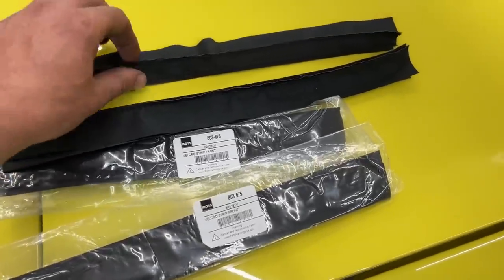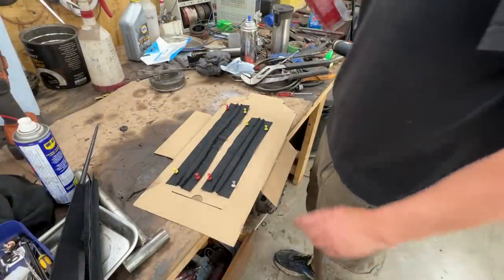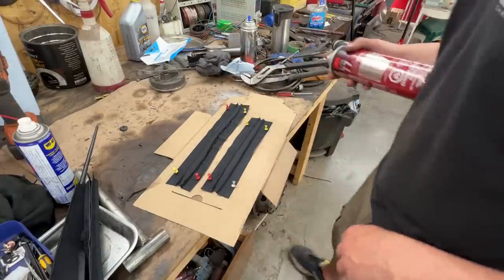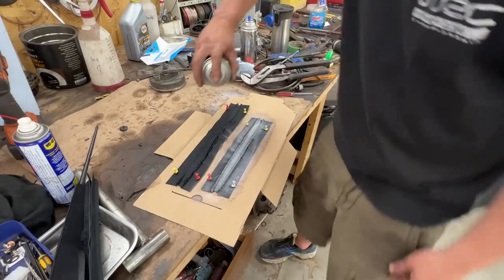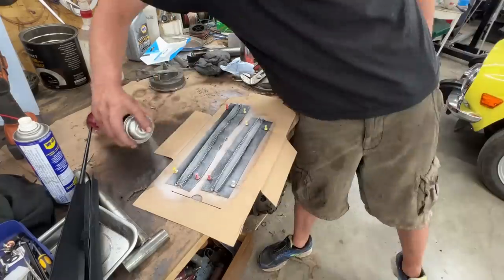So we have four pieces of vinyl with velcro stitched together - two long ones and two short ones. The short ones are for the front piece and the long ones are for the rear piece. The velcro needs to end up on this side of the rail. I ran out of my favorite glue a long time ago - I need to go buy some but it's far. So I'm using Super 77 by 3M, and it works well. I'm going to spray everything here now. This glue needs to be sprayed and then left for a while to become tacky - then it has the perfect strength. Apply it generously, especially at the edges, because even if it doesn't glue well somewhere in the middle, it's important that the edge sticks so it doesn't start peeling.